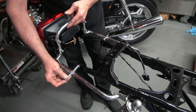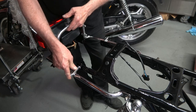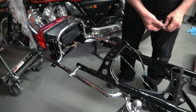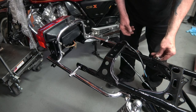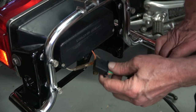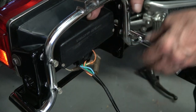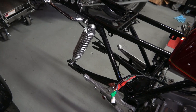I'm installing the taillight assembly and the grab rail, putting these long bolts in to hold it in place because they actually screw into the rear fender — in the next video I'll be restoring that rear fender, both outer and inner. I've just got the bolts in there to hold it in place right now, and then I go ahead and plug in the harness into the taillight, which is much easier to do at this point. There are those items reinstalled onto the bike.